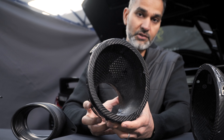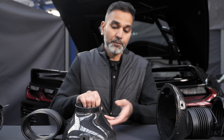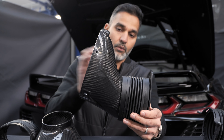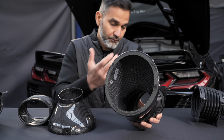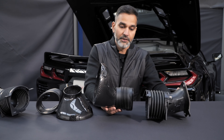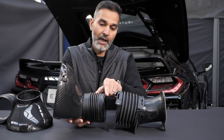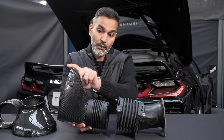You can see there's a dramatic change in cross-sectional area — the volume changes rapidly. So the assembled part looks like this: you've got your airflow coming in from the side panel, through the rubber section, and then into our carbon fiber duct which opens up dramatically in size. The inside of that carbon fiber is fully pre-preg, so you can see carbon fiber on the inside and it's smooth as well. In comparison with the stock, whereas the stock part retains the same internal cross-sectional area all the way from the panel to the airbox, our one opens up dramatically as soon as it exits the rubber part, and that then mates to our central airbox area.